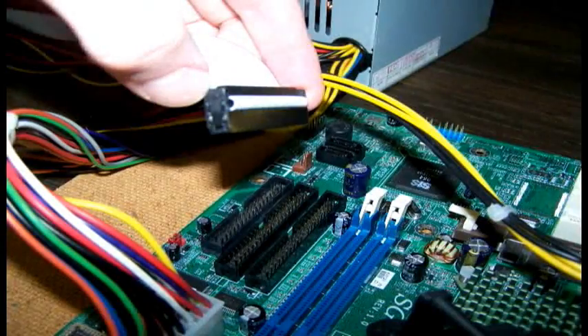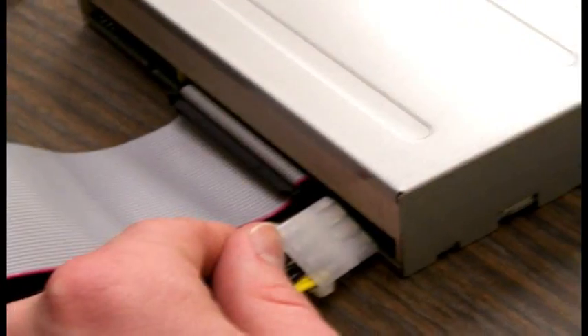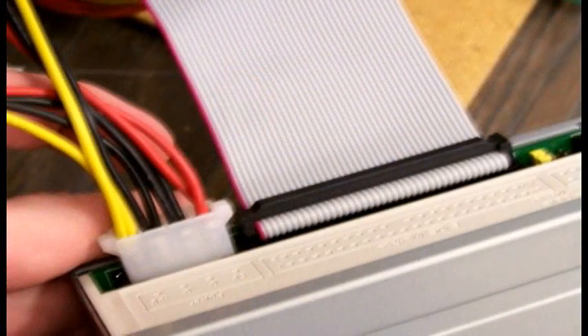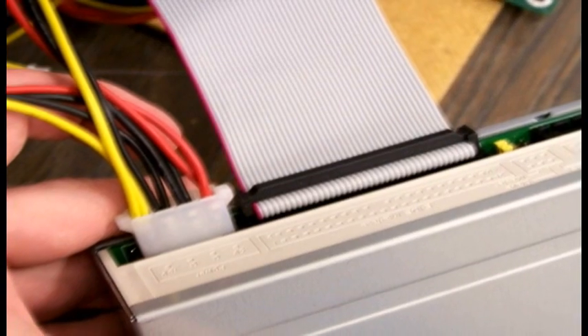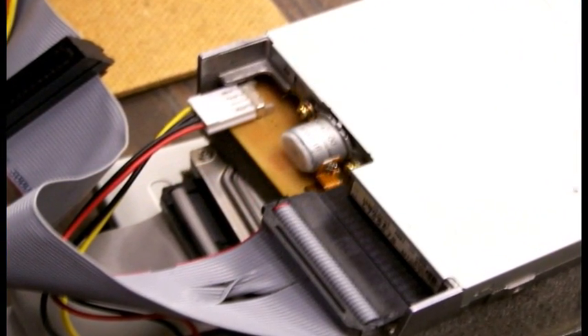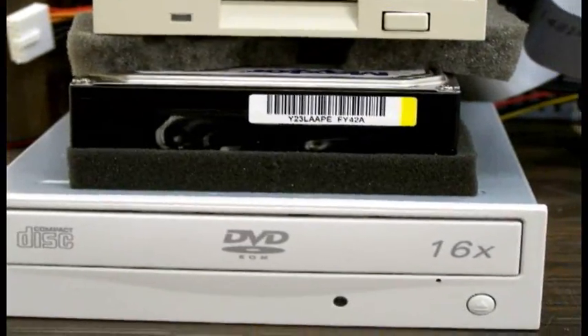Now is the time to connect the cables. Also connect the 34 pin floppy drive cable to the remaining IDE cable connector. Now connect all the IDE cables to the back of the drives they are supposed to be connected to. Remember the red stripe still goes to pin 1. Also connect the correct power cord from the power supply to the back of the drives. You can stack the drives on top of each other, but be sure to place something that is not metal in between them.